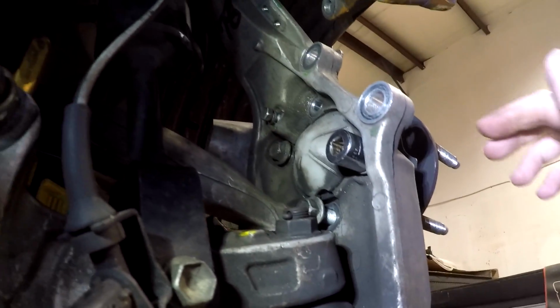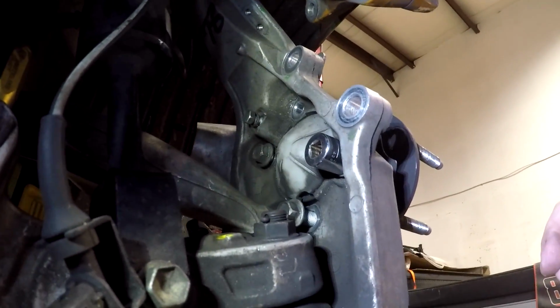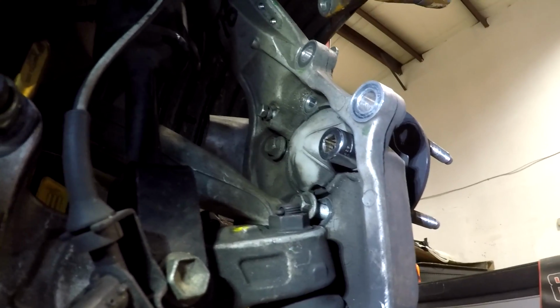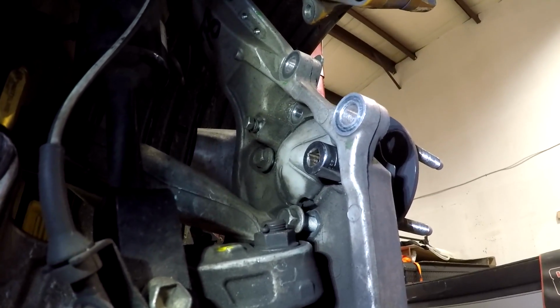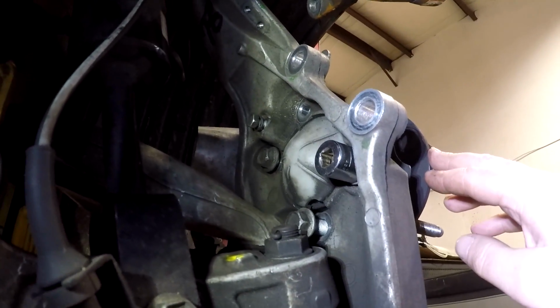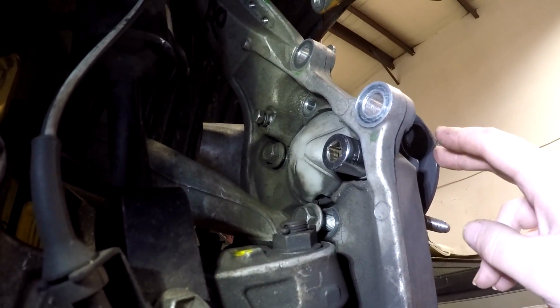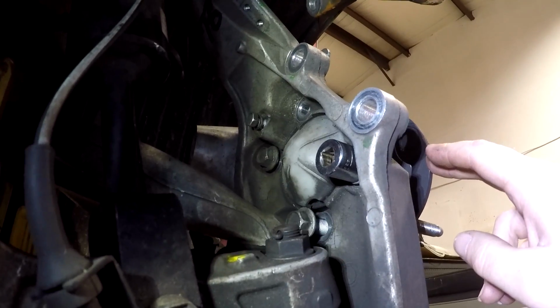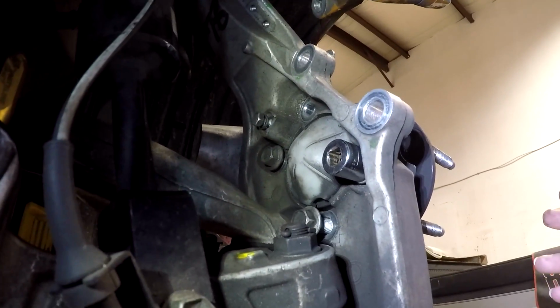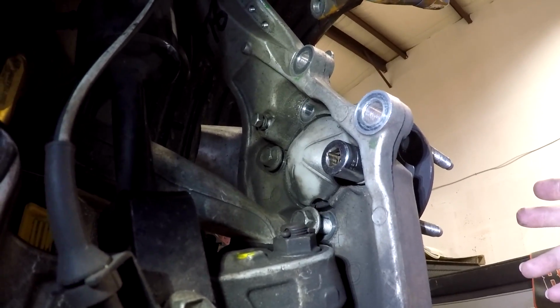At this point, I've got all the fasteners loose. I've actually removed the upper and lower fasteners. The lower fastener actually does hit the knuckle if you had the wheel straight, so I'm just going to leave it there. It's no longer bolted in. Removing the hub itself can be a challenge, especially if it's the first time you've ever done it, or if you live and drive your car year-round where it might get exposed to salt. In my case, mine have come on and off so many times that mine are easy to get on and off.